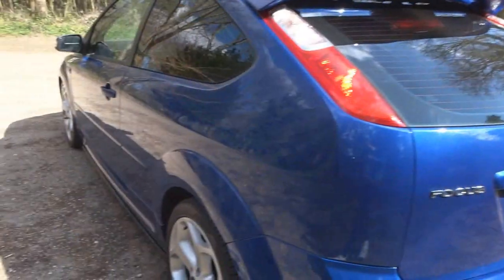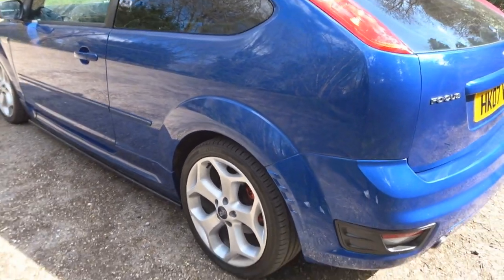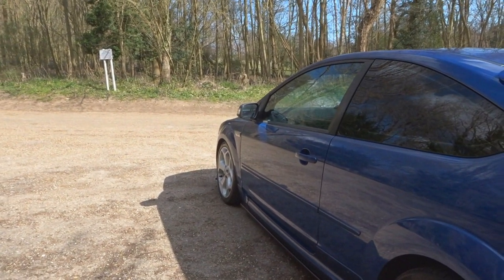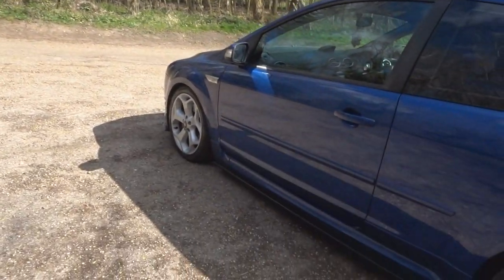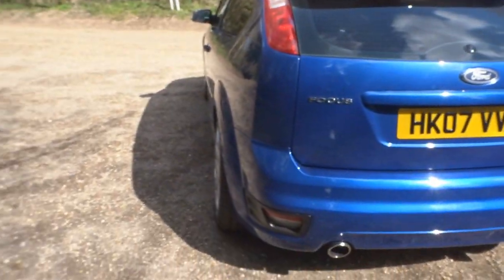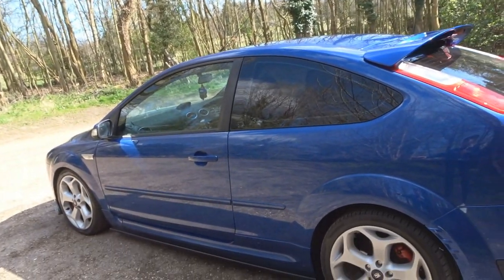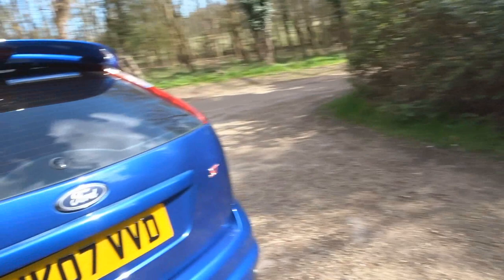On the back of the car I've got 15mm spacers — they are Dorenza spacers, picked up off eBay for about £75. I was thinking about getting some for the front as well, but I've heard that fitting spacers on the front can help ruin your drive shafts, which these cars definitely don't need help with since they tear through them anyway. The rear spacers make it look that little bit wider and give it a nice fitment — I think it could do with going a bit more, maybe 20mm. A lot of people do 20mm on the back and 20mm on the front, and you shouldn't have any problems with that.